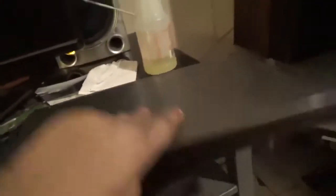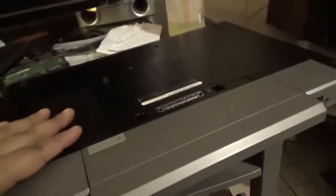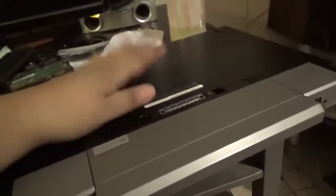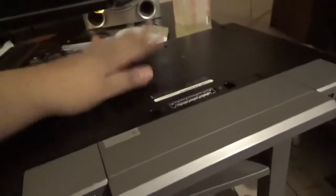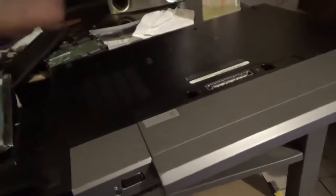I'm going to show you guys how to upgrade the RAM on my laptop. This is pretty much the same procedure for all laptops. First thing you gotta do is take the battery off. On this one the bottom plate slides off, so the memory is right there — it's really easy. Other laptops you have to take the keyboard apart and take half the thing apart.